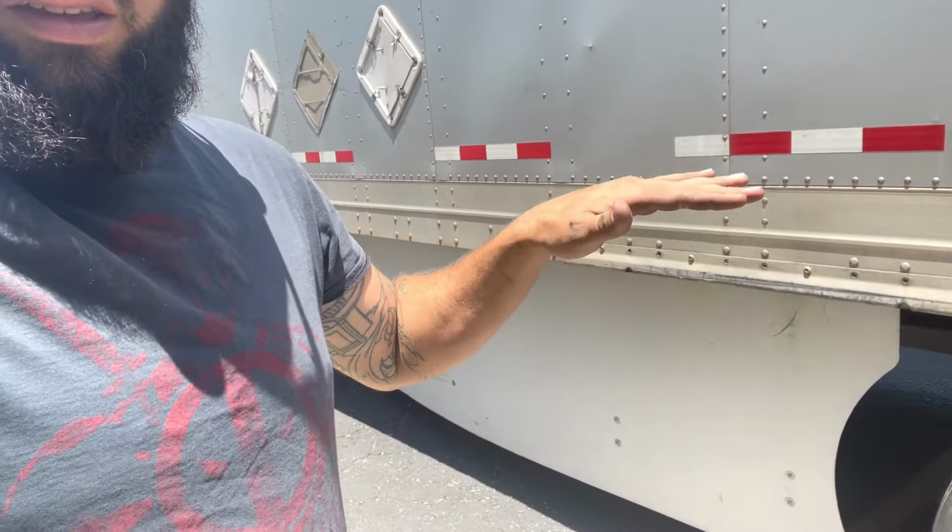They're moving as they should be, which is, you know, the feet of the legs. And, you know, obviously make sure that my fifth wheel was greased. So we're good, man. I ain't got no leaks and the lights are all working. There is no compromises. You really want to make sure that you watch this here, the deck. Make sure that it's not coming apart, because it happens. I've had it before. So have other drivers. You know, you stick around long enough, it happens.